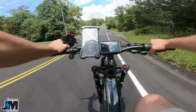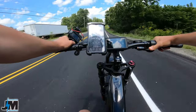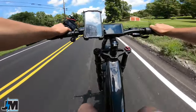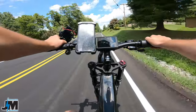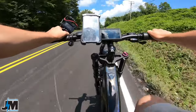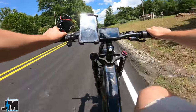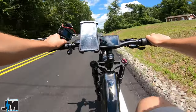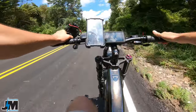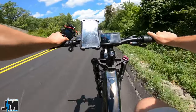We're going to see what kind of speed we can maintain on this main road going uphill. It's currently outputting 1,256 to 1,270 watts out of this 25-amp controller — I did take it out of the bike and verified it has a 25-amp controller. It peaks out somewhere in the 1,200-watt range. Having that power, I'm able to maintain a pretty nice speed coming up this hill, which is nice since I don't like being on these main roads too much out here in the country.